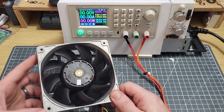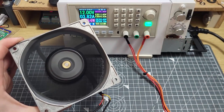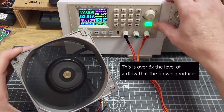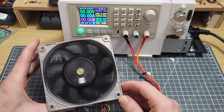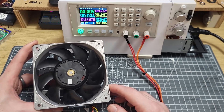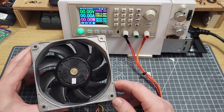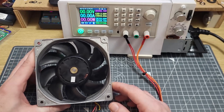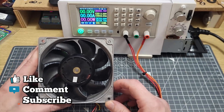Without further ado, I'm going to power this up and let's see what happens. It's just going to blow absolutely everything off my desk. To wrap up: blower fans are really good at developing high pressure but not good for high volume flow unless the fan itself is very large. Axial fans are not good at developing pressure, but they are very good at producing high volumes of airflow, which makes them perfect for use in computers. Anyway, I'll be back again soon with another video — thanks for watching and I'll see you next time.